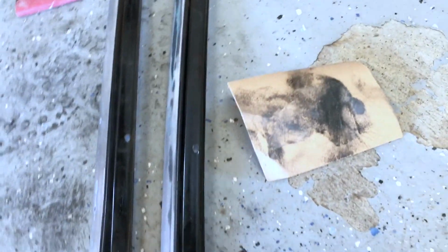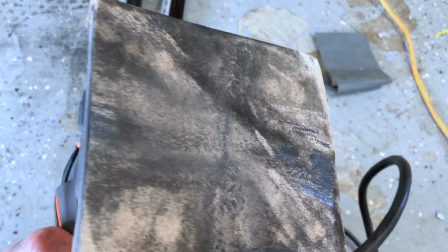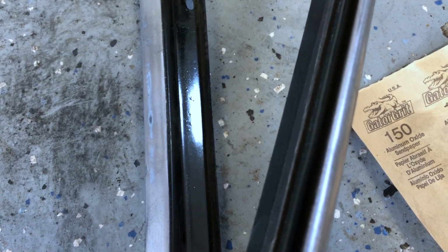Just thought I'd tell you all what I'm using for sandpaper. So I'm starting off with 150 grit and hand sanding it down, and then I've also got a palm sander too. I'm just using a finer grit with that, and going where I can just to get the general surface area. But on the sides, you guys want to be careful, because it gets a little cracked up and you can barely see it. Make sure you clean that up so it's nice and clean, no cracks, and a clean surface to paint on.